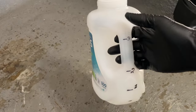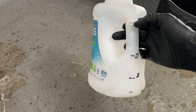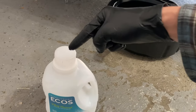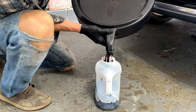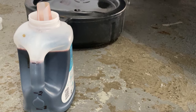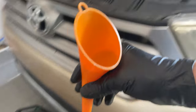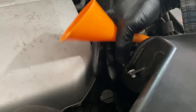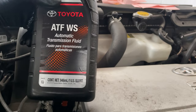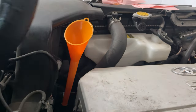We didn't have a lot of empty containers around the house, but I had this old laundry bottle. I measured every quart as I poured it in with a measuring cup, and I have at least three quarts of space here. I'm going to dump what we drained into this — I can confirm it's at least three quarts. We've reached three quarts, which is full capacity for this jug, so we know we can put at least three quarts of new transmission fluid into the transmission. We're filling it through the dipstick tube using a funnel. I did get the official Toyota automatic transmission fluid — I wouldn't recommend using anything other than the manufacturer's transmission fluid for this — so let's go ahead and add our three quarts.